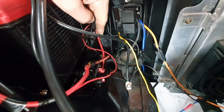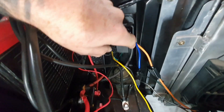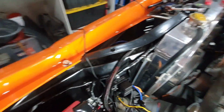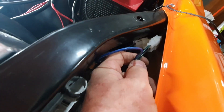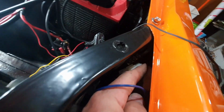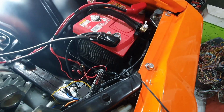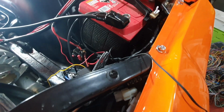It's quite a heavy cable - I've put a bit of heat shrink and sleeving on it just to make it tidier. The green wire you see down here runs off to the trinary valve for the air conditioning. That trinary valve - I still need to tidy this wiring up - is down here on the dryer. You can see there are two sets of wires: the blue wires and the black wires. The black wires are the trigger ones that come through the harness from the air conditioning unit in the car, which switches the trinary valve on.